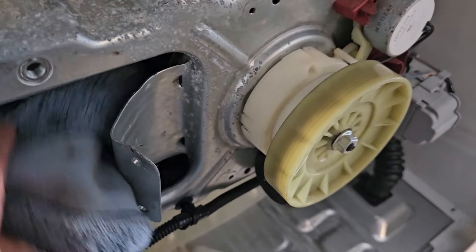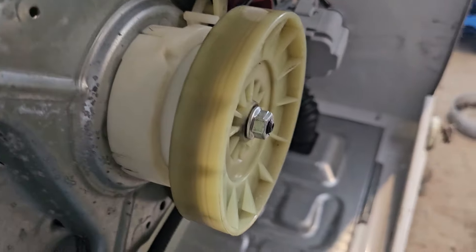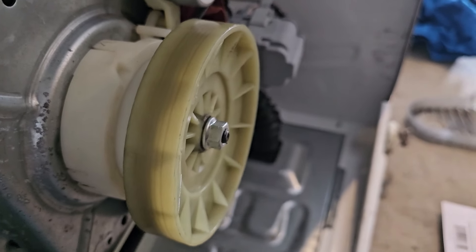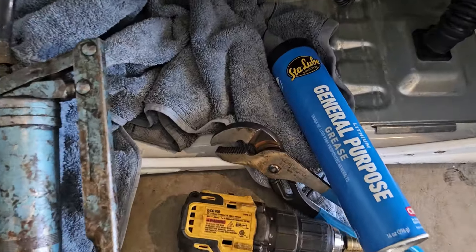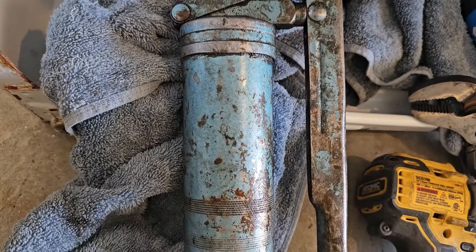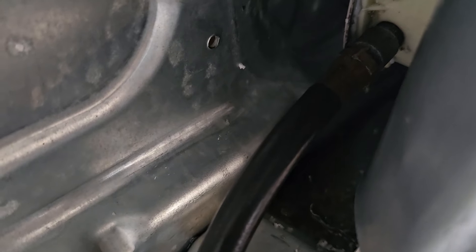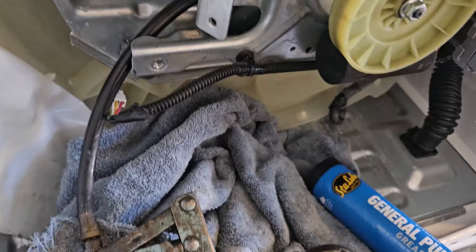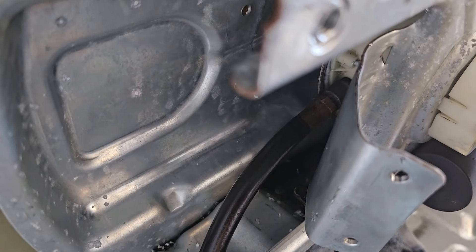I've got the hole drilled out. Now I'm going to stick some old towel underneath here and then turn the transmission by hand and just let it drain into that towel. You can actually turn this whole piece like so and it should drain out whatever remaining oil is in there because that moves the hole down. Typically I'd recommend lithium grease, but my grease gun is already filled with some moly grease and I don't want to pull the tube out halfway because it's quite messy. I've got the grease fitting of the gun plugged into the transmission hole that I made, and I'm just going to pump it up until it fills all the way, then clean it up a bit to make sure there's some air room so it doesn't get over-pressurized.